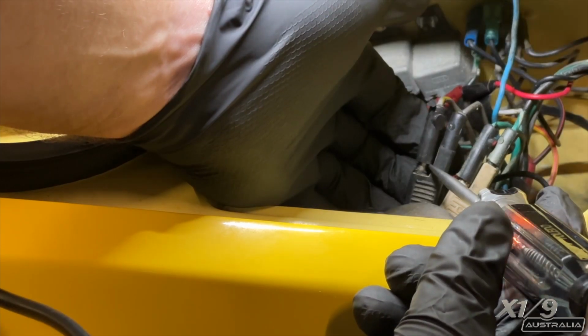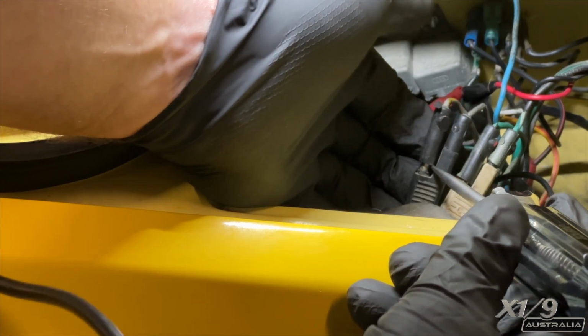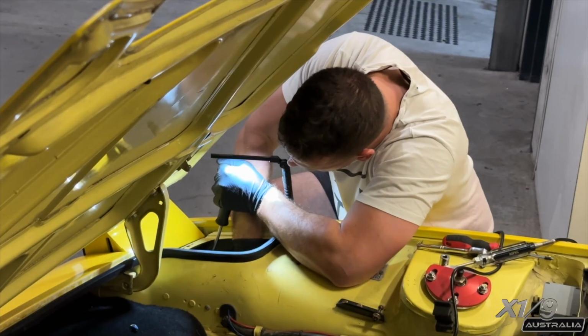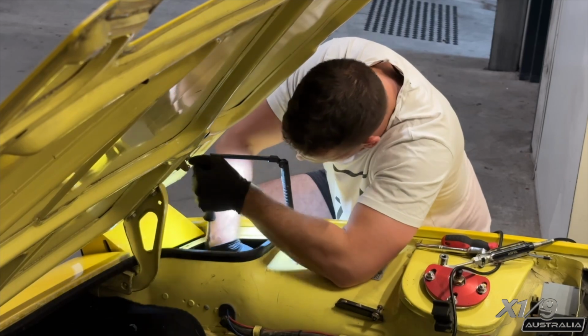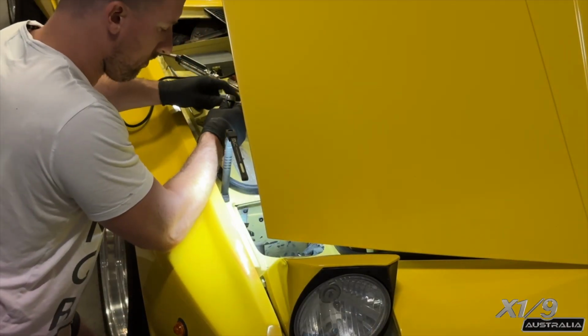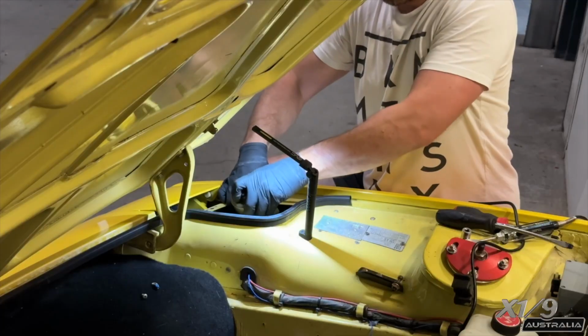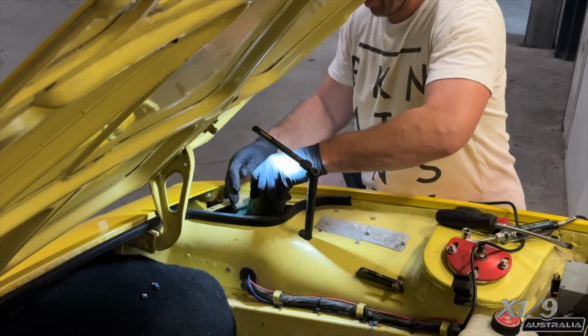The next thing to check is there's power going to the motor, and there is. Seeing the pod is only working in one direction, it has to be the diode, so out comes the motor. 3 bolts hold it to the chassis and 1 nut connects the pod. Now it's only a simple matter of dislocating your wrist so you can get the motor out.